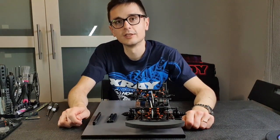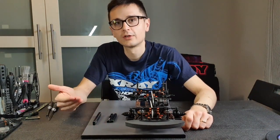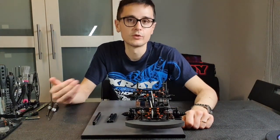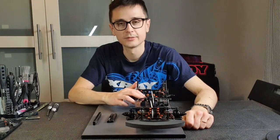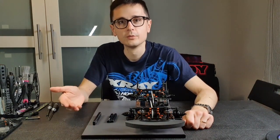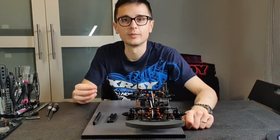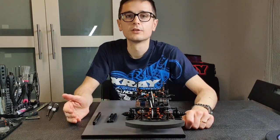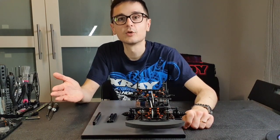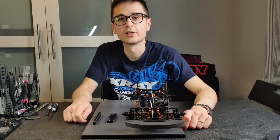You can also use the difference between front and rear downstop values to fine-tune the handling — a smaller or bigger gap between front and rear. For example, if you add more droop to the rear by opening up the downstop screw in the rear, going from 4.6 to 4.4 or 4.2, this will make the car roll more over the rear. You're playing with the balance of roll between front and rear. Going to a lower number in the rear helps the car transfer more weight from rear to front off power, giving more steering off power and helping the car rotate.